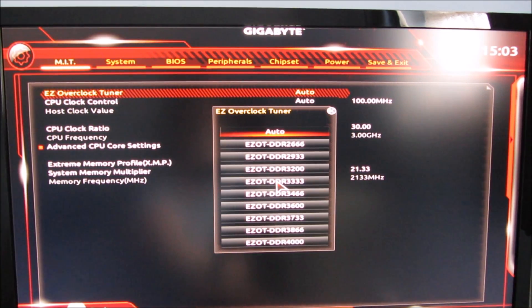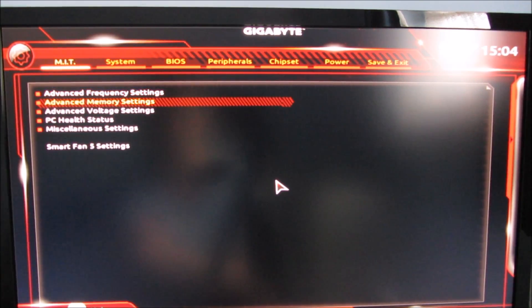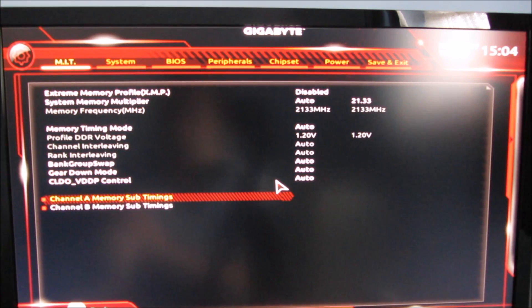In the first option we can set our various frequencies. On the memory side I've tried 2666, 2933, and 3200 MHz with both two and four sticks, and with XMP, and so far I couldn't get anything to work. I ended up having to stick to 2133 on this update. Before, 3200 did sort of work but had a few issues — now it just refuses to even start up. The memory settings are basically left at default which is not ideal, but with four sticks Ryzen does seem to be very temperamental with memory.